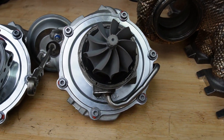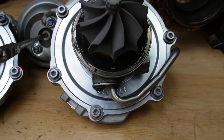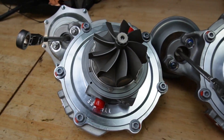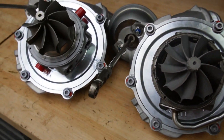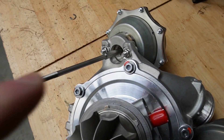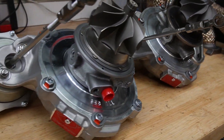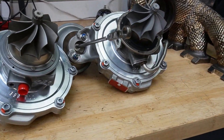Kyle has removed the manifold and now we see the original 855 exposed with that 777 backplate on there. The new unit has a fancy new backplate that says 855. The turbines look absolutely identical — nothing has changed there — but the rod length has definitely changed; it isn't quite as long on the new unit versus the original. There they are side by side. Hopefully this is going to be that much more responsive.